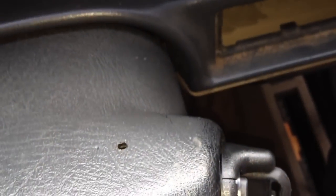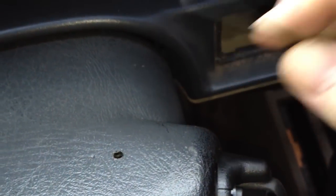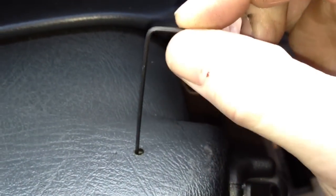That's why that hole right there is lined up pretty much with that hole. You take a small allen wrench, which I have here. Please disconnect your negative battery terminal before doing this, because you will have to turn the key to the start position. You don't want your truck to try to turn over as you're doing this. You insert the allen wrench in there.